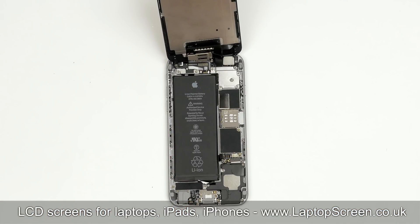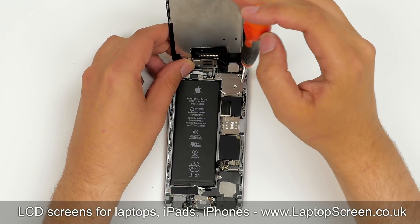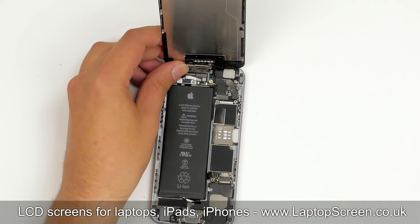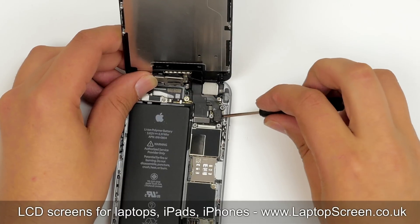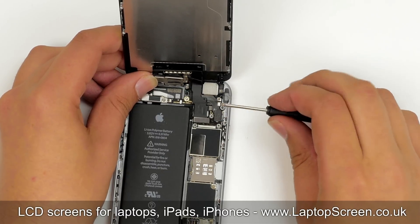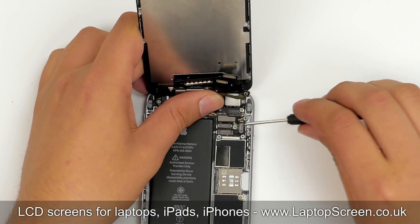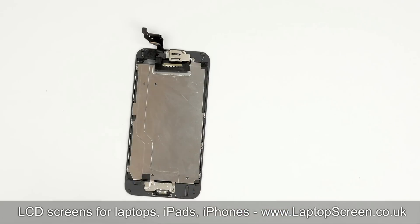In the top right corner, you can see a small metal shield held in place with five Phillips screws. Remove the screws, keeping in mind their position, then remove the metal shield. The next step is to open the four connectors — take a flat screwdriver and gently pop open the connectors. Separate the front assembly and place it on the desk.